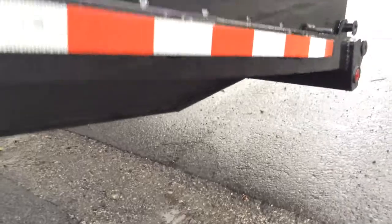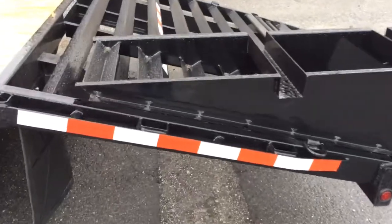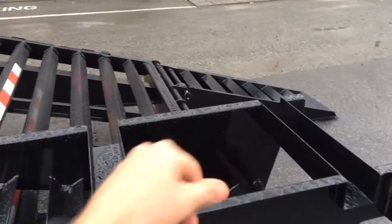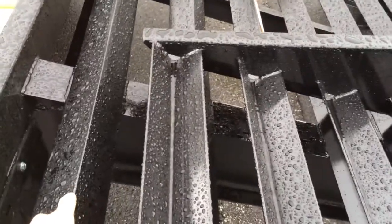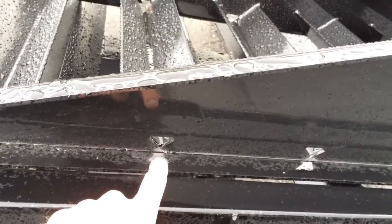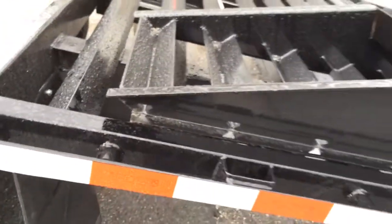They also continue the I-beam frame the whole way back, including the dovetail. Speaking of the dovetail, there are a number of very nice handy features worth pointing out. They give you two D-rings and cutouts where you can put four-by lumber across, so you could load the full deck length and gain an additional five feet. They do three-by-three-inch angle treads instead of a two-by-two, which closes up the hole and makes it a little bit safer. They also give you weep holes so the angles can drain — many trailers don't do this, and that's traditionally a big rust area, but the weep holes let water drain out of the ends.